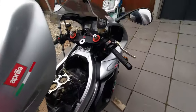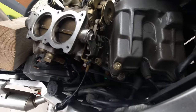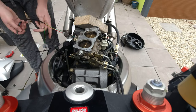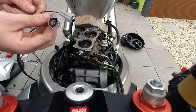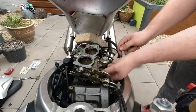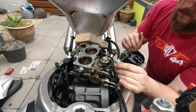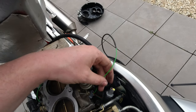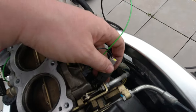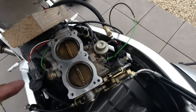There are two different types — one is coils and one is injectors. I have my two coils here but it doesn't look like the plugs for the coils, so I have a feeling it's these guys here which would be my injectors. These plugs here are little kind of piggyback plugs. You just want to make sure that they all actually click home because these ones didn't click the first time, so give an extra push. So that's all it is — the injector on this side and the injector on this side. So we're cutting fuel rather than spark on this bike.